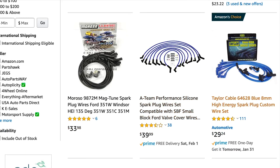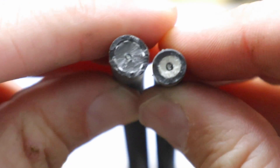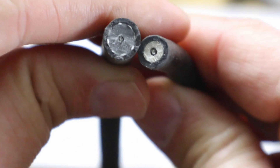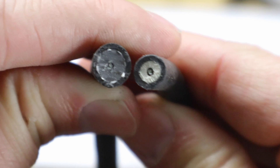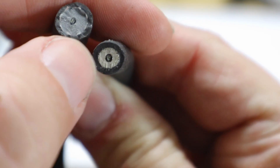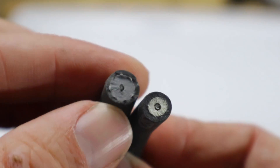Further down you'll probably see some 8 millimeter wires. Thicker is not better — don't buy a wire because it's thicker. I have two wires here, and the white insulation versus the gray Ford Racing wire shows that the gray one has more insulation making it thicker. But the silicone on the outside or the insulation inside isn't the thing shielding this wire from outside interference, and it's not keeping that electronic pulse in the wire either. The shielding comes from the suppression layer — that black layer inside — which is actually keeping the current in the wire and keeping outside current out. So it's not necessarily wire thickness that makes a superior wire.